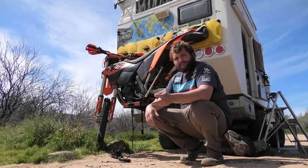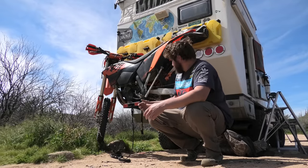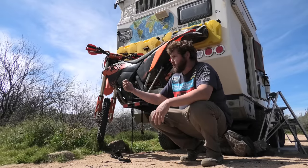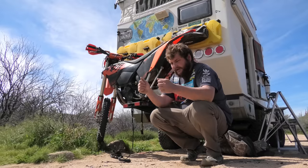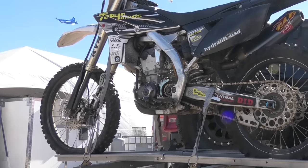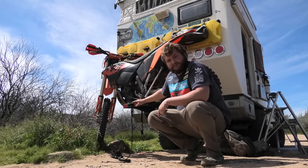The second great thing about this design is it doesn't put any stress on the suspension. The suspension is hanging there, fully drooped, not compressed at all. You can blow your seals on your forks just by tying your bike down too tight on a flat platform. I really like that it also keeps no flat spots on the tires. That's why I love this style of hauler specifically.